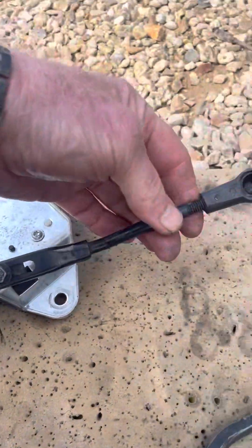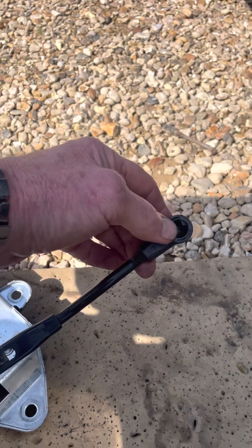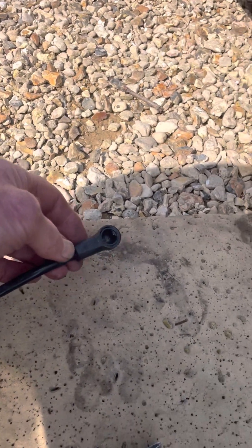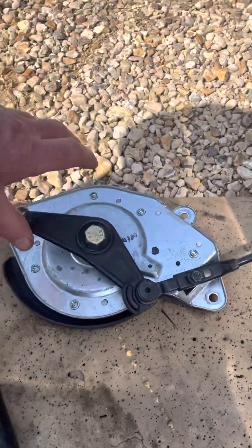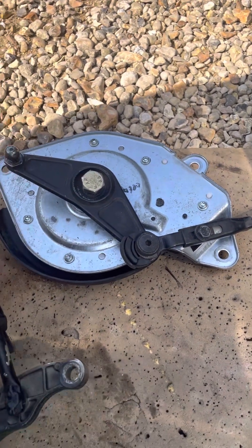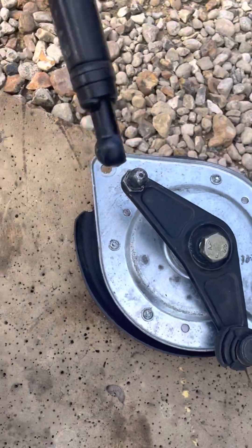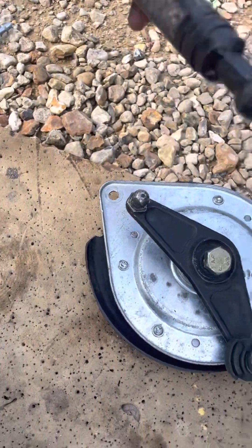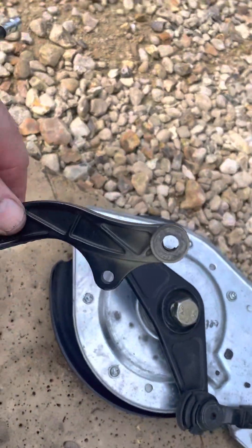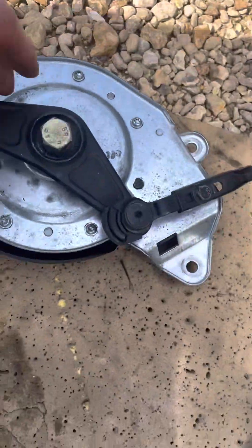As I showed you before, that's the part that goes onto the hood itself - the ball that goes onto the socket. These sockets are plastic and can be replaced; you can find replacement sockets and they just screw on. The plastic is intentional because the mechanism is quite strong, and plastic will break first to prevent more serious damage. This end goes here, the other goes on that end, and the cam shell attaches there.